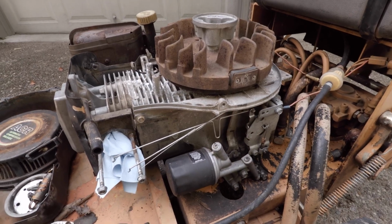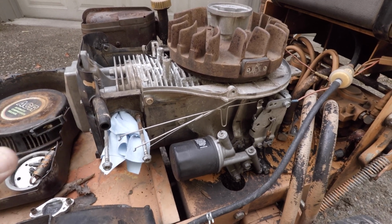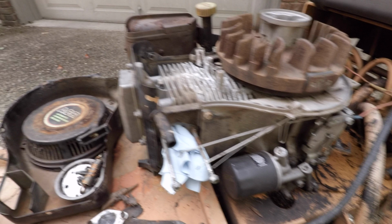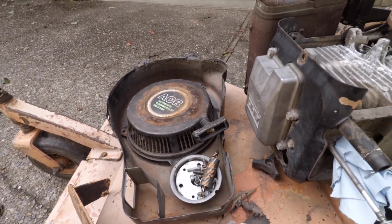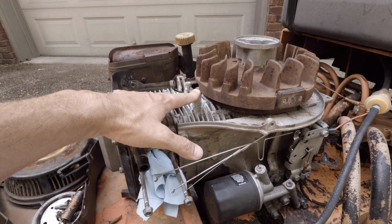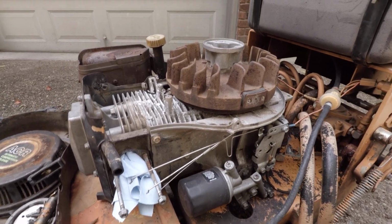When I looked up the specs, the only thing I've done off camera was test the compression just to see if it was worth ordering parts, and the compression came in at the low 70s. At first I thought, man, that's really low, that's bad. But then I saw that it had the ACR valve, and the service manual said it should be 71, so that makes more sense. So I'm hoping if I get a carburetor, an ignition coil and a few other little parts, we can get this thing hooked back up and see if we can get it to fire. So that'll be the next video.